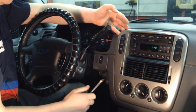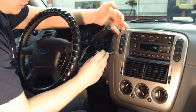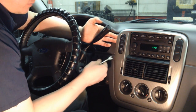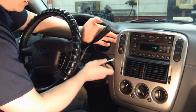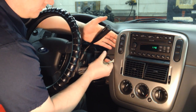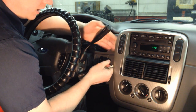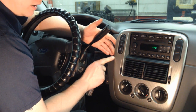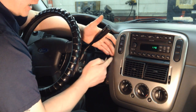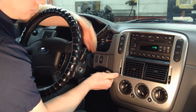If you have your fingers behind like this and you're putting pressure outwards, then go down and keep popping it. Put your fingers in here so you won't press against it and make an indent — your fingers are doing all the prying. Put your knuckle against here and pry off your knuckle instead. You need to go down until you find the next retainer; you can feel it. Go down another inch, get right on top of the retainer, pull it out, and do that all the way around. Be patient.